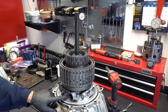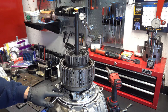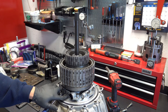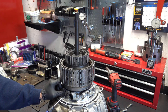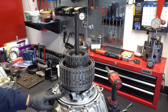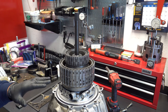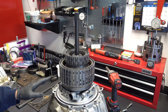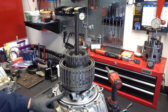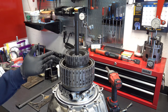What you want to do — and I should have done this for the 1-2-3-4 too, I'll go back and do that — is put your finger here. What you're wanting to feel for — or I should say not wanting to feel — is air forcing its way out of this circuit when you're putting air into this circuit. I don't feel any air there. So we'll go back to the 1-2-3-4 and put our thumb on the 35R. No air is coming out of here, and that's exactly what you want. If you have air coming out, then that means you have a cross leak. In the older first design stators, this was very common. If you had tie-ups, bind-ups, or stack shifting, you would drop the valve body complex, put air into this circuit and that circuit, and look for fluid spraying out of the other one adjacent to it. If air goes in here and fluid and air is coming out of here, you have a cross leak and the trans has to come out.